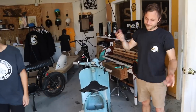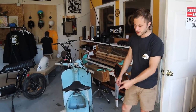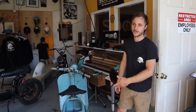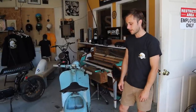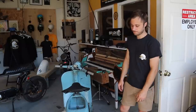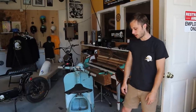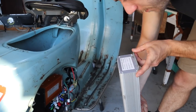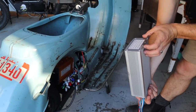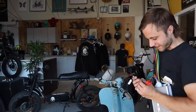On day three, Matt explained: the motor was wired up in reverse, so they used a controller with an intelligent programming feature that you can basically plug anything into and it figures it out. The only problem was that controller was rated to about 30 amps, and they really needed 45 amps out of it. It would get up to speed and then cut out — you'd have to pull to the side and wait for it to cool off. They needed a bigger, beefier 72-volt, 50-amp intelligent controller to handle it properly.